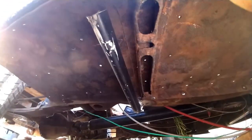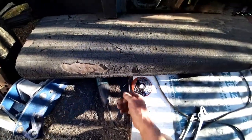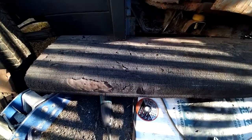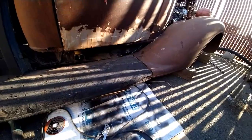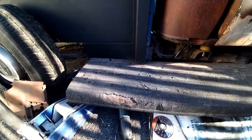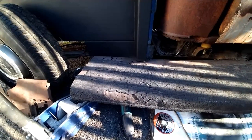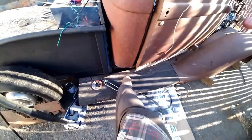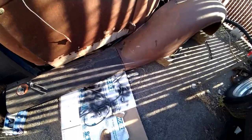The braces — I don't know if you can see but they're missing by a couple inches. I'll probably have to jack it up and figure out some bracing for that. Looks like the fender's right here and braces here, so I might have to put tabs on it. I got the fender on and it looks like it's lining up — it went flush against the bottom part of this bed here so I could put a bolt in there. We'll throw a couple in front and see what it looks like, bolt it up good and tight.